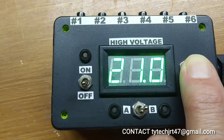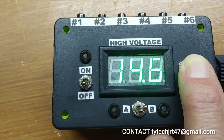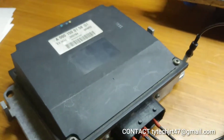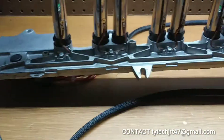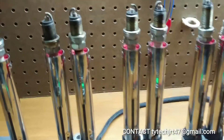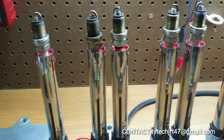Within less than a minute we can pull the voltage down to a safe level. We're down to 23, 22, 20 — below 15 volts we're safe. Now we can disconnect and connect to the other side of the voltage transformer, or disconnect the coil pack and connect the next coil pack to be tested. It is crucial to have spark plugs in the coil pack when testing, otherwise you can damage the coils.